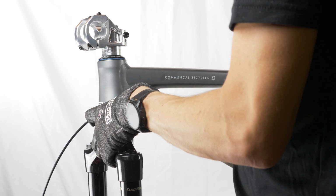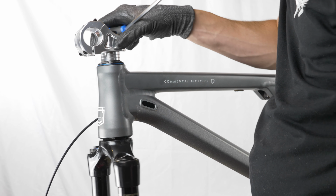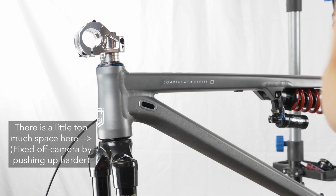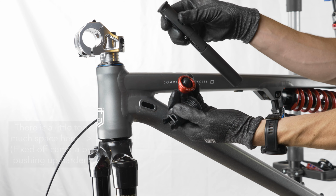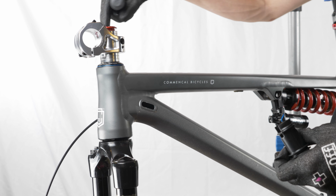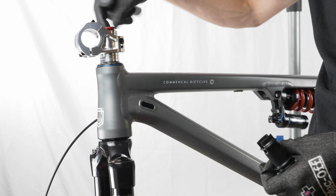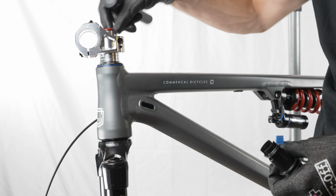from the UK. Once that's set, the next step would generally be to cut your fork to the size you'd like and install the star nut. But my fork is already cut and I've got something else in mind instead of a star nut. You may recall that this used fork came with the frame. Well, it also came threaded for the 1-Up EDC tool, so I figured I might as well install one of those. That means there's no star nut.